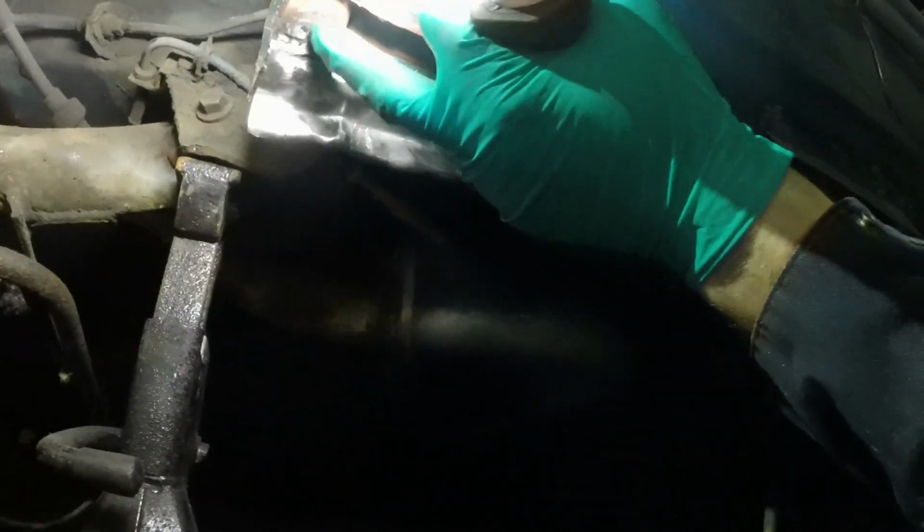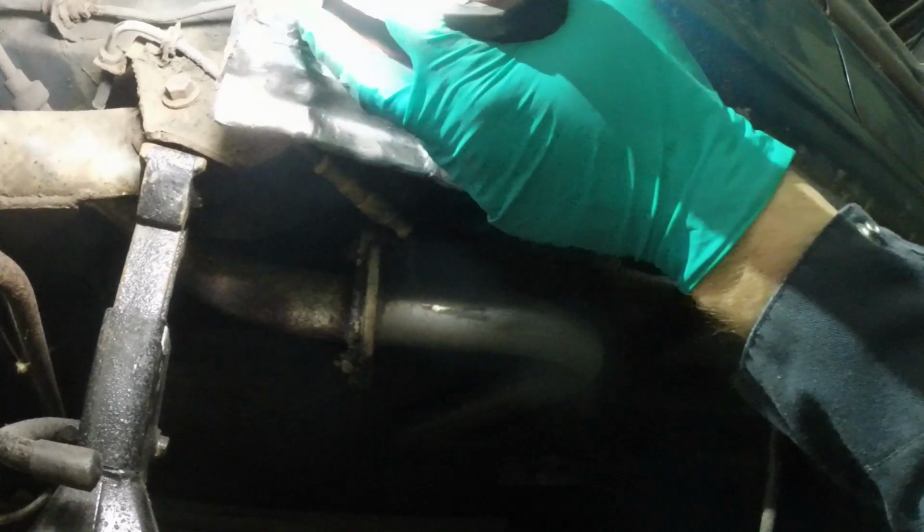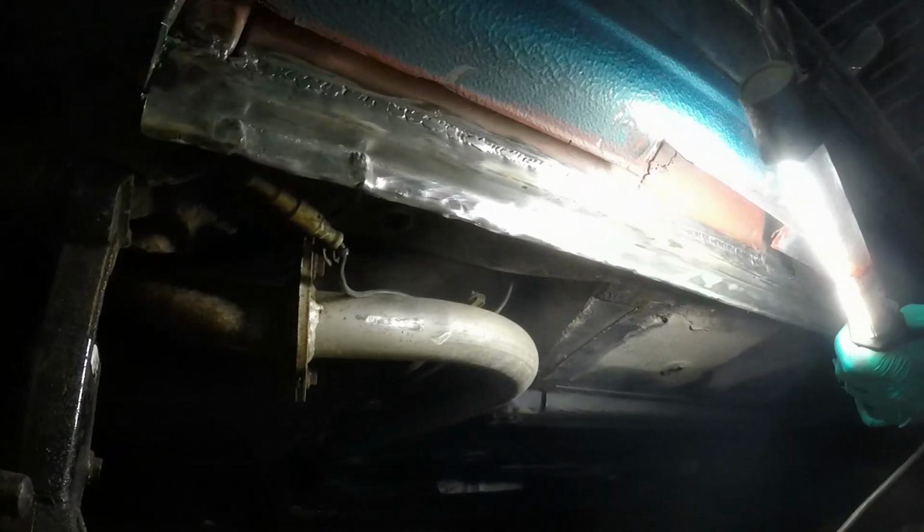I've also spotted a couple of welds where after I've ground them it's gone through, so I'll have to patch them with weld anyway. Which means if I'm doing welding, I could always build these edges up with weld and then sand them so that it gave a nice crisp edge. But I'll keep hammering to start, and hopefully I won't need to do that.